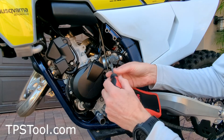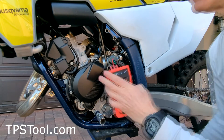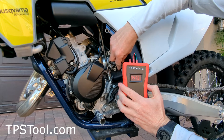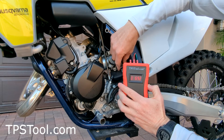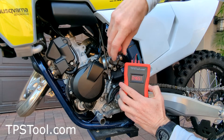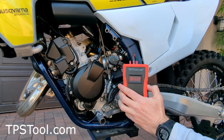So we're going to switch our bits here. We're going to loosen these screws. Now we're going to rotate the sensor until it reads 0.46. Note the reading may change a little bit when you tighten the screws, so just be aware of that — you may have to try a couple of times to get it where you want it. 0.46. So now I'm going to snug the screws up. There we go. So now we're set to 0.46 — it's going to be a little bit leaner than it was, and we'll take it out and see how it works.